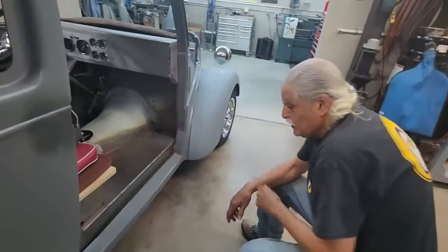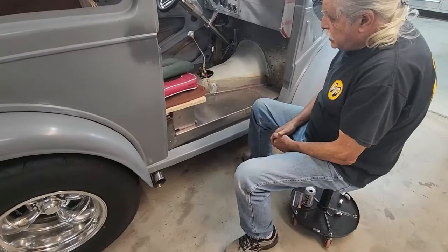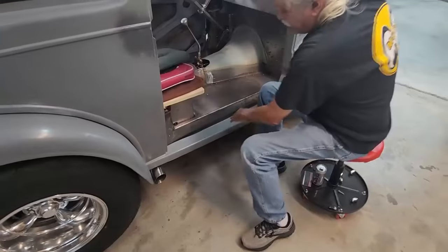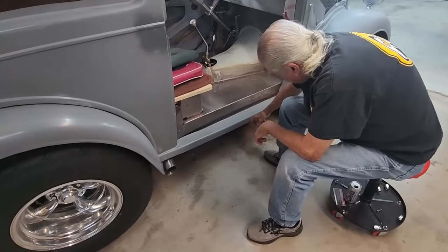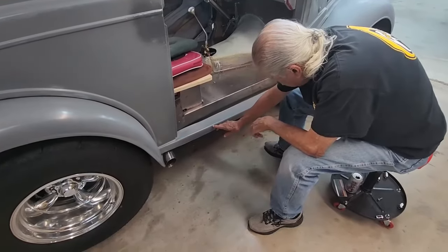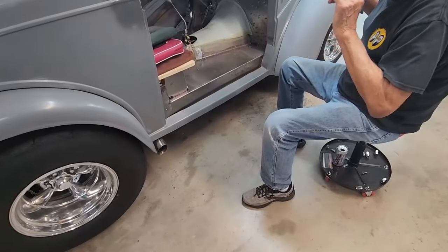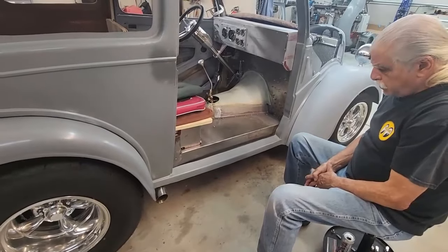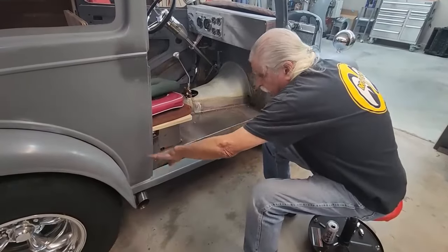Okay, here's Lou looking like Rodin's Thinker. What are we going to do? The steel doors are a quarter inch larger than the fiberglass doors. So for it to fit in here, I'm thinking of putting a piece of wooden strip underneath this and gluing and screwing it onto the bottom of this here. Then cut this piece out and drop it down, and the bottom of the door will fit all the way in. Then you adjust the bottom to close the gap up to whatever it takes. By putting a piece of wood in here, that'll keep all this together and stiff.